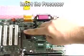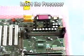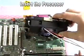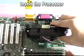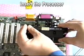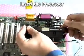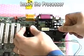When you're ready to install the processor, examine the retention clips on both sides of the slot. Now gently slide the processor through the retention clips and press it gently but firmly into its slot on the motherboard. When the processor is fully mated, you'll hear it and you'll see it clip into place on the retention clips.